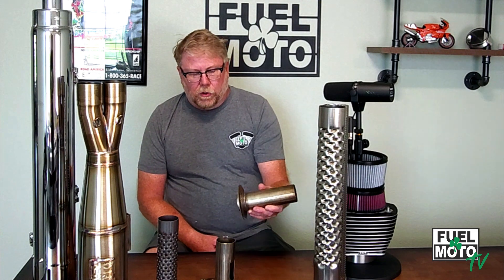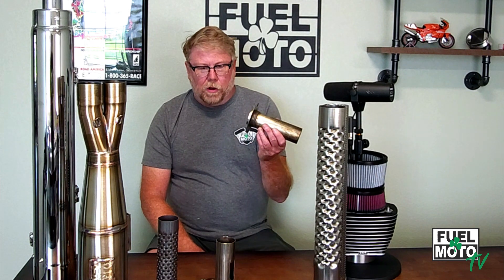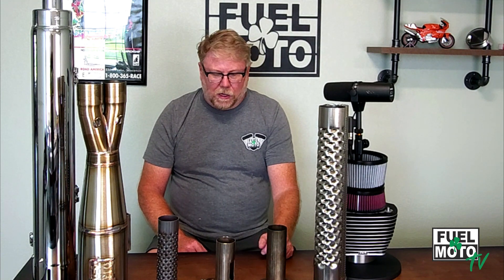Some of the stuff we've worked with over the years — like our E-series exhaust and the diffuser discs — gives another complete level of tunability beyond what the ECU and the tune can deliver. This is a really popular insert, all of our Jackpot mufflers come with it. You can pull one out independently or use two. A lot of the high-horsepower M8 stuff — we may just leave the right insert in. Builds we do with our Triple X head pipe on 128 or 132 engines making 155 to 165 horsepower, we still leave one insert in — the right insert — and that really lends well to the power curve and the way the bike is balanced.